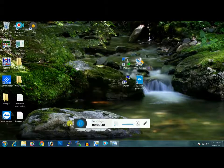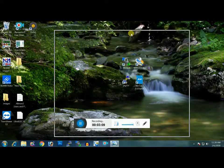We'll be back. Okay, next thing you need to do now that the image is written, go ahead and close Win32 Disk Imager, eject the card, put it in the Pi. Make sure the Pi is not powered up when you put it in. Remove the power adapter. Put the card in the Pi, boot it up, and the first thing you're going to need to do is go in and configure your router, and you need to check some information.